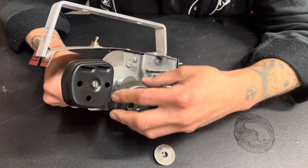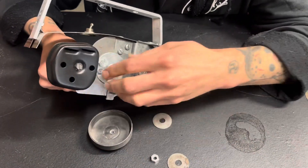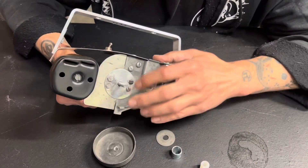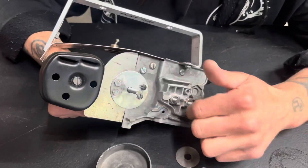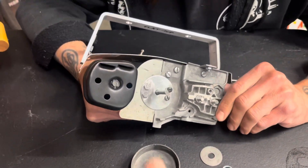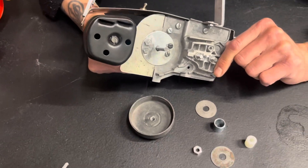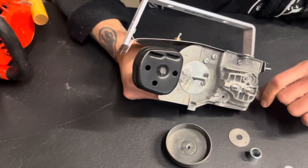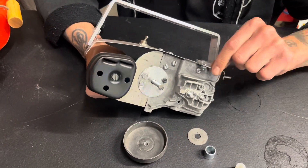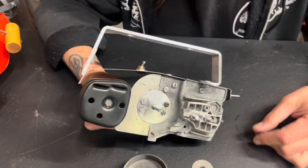It's the original bell for the clutch — I fill it in and re-tap it so it has a solid state to go up against a washer, metal sleeve, and spacer. You are going to have to cut those down; they're not going to be bought at a standard size. Then just a fender washer, drilled and bolted secured. There's metal running through the back — we'll show you that. The holes are properly spaced and put in correctly for the flat top.